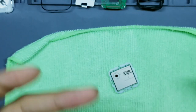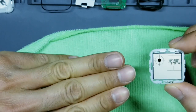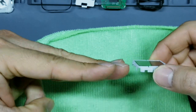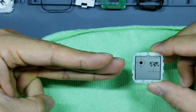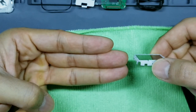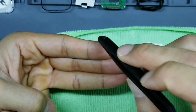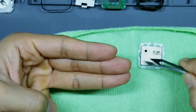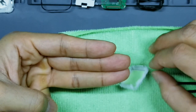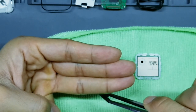You can simplify the understanding of the display as thinking about it in three layers. So if we're focusing on layers on my fingers on the left, we'll turn the display this way. If we're thinking about it like this and we turn it this way, the display is made actually out of three layers, okay? So you're going to have a top layer here, which is what you see here at the very top. You're going to have a middle layer, and then you're going to have a back layer here, which is what you see here behind. Okay, it's almost like a hamburger. We have the patty and two buns.